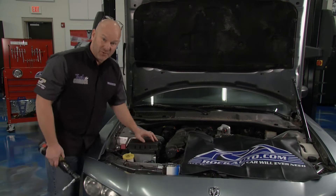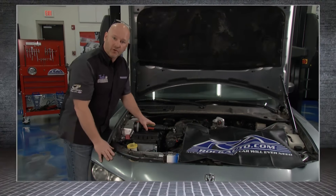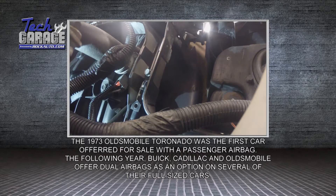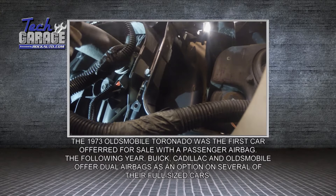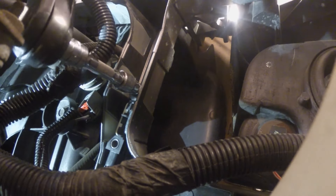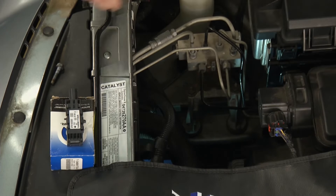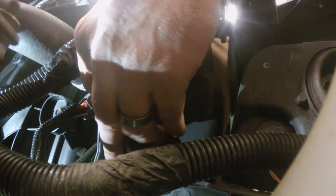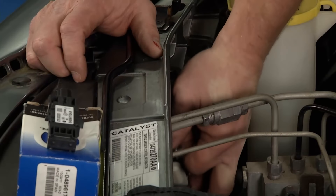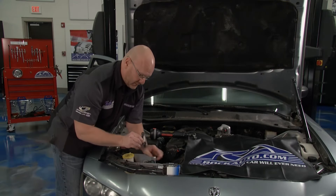That was an awesome demo — I'm glad I was over at the toolbox for that. It shows you the amount of power in just one airbag and how hard they're working to save your life in a compromising situation. I've got one bolt out on our old sensor — just two ten-millimeters, very simple. The real magic on this project is getting the proper diagnosis and understanding exactly what needs to be replaced. Remember, we have it disconnected. Pull out the bolt — when you pull your sensor out, take note of the orientation: white side in, connector at the bottom.